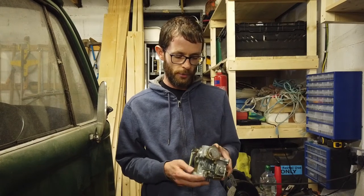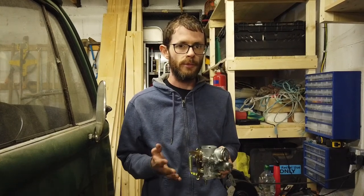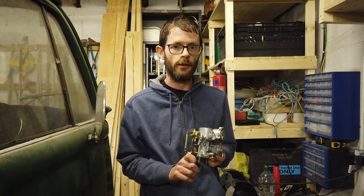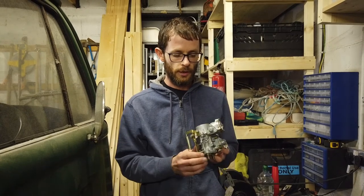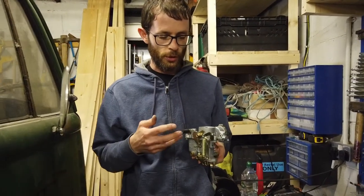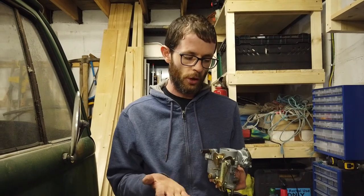What a carburetor essentially does is it atomizes the fuel that goes into the engine. Fuel can only be burnt in a suspended form, so it basically functions like a spray bottle, like a perfume bottle. When you spray something like an aerosol, all the particles end up being suspended in air. This essentially does the same for fuel. It also controls the fuel air mixture going into the engine. So it's a pretty simple device, but it does a lot of functions, and it does them all completely mechanically